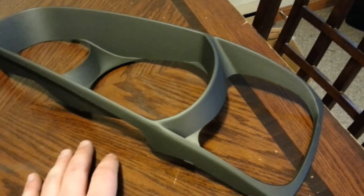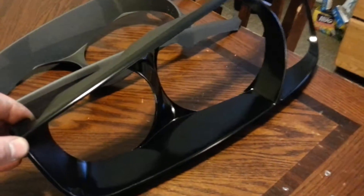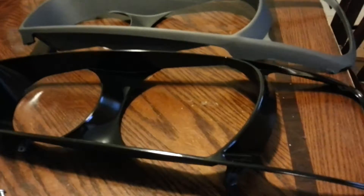The plastic bezel comes out. Now you can see this one is gray — pretty boring looking. A lot of times cars come with a chrome or black bezel, but this side I already went and painted. Like I said, I used cheap Walmart black paint at 97 cents, high gloss. Some people are going to say you've got to use high temp paint, but I've done it in the past and haven't had any problems. This is what it looks like stock and this is what it looks like nice and shiny black. You can use high temp paint if you want, just to be safe.